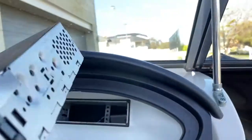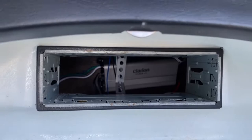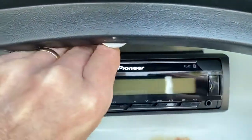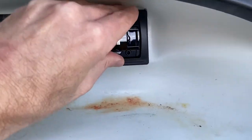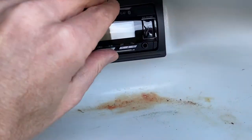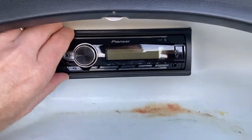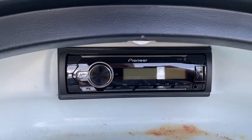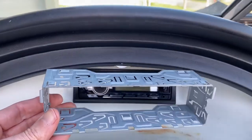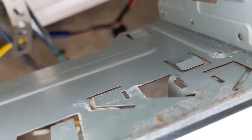The old head unit has now been removed, leaving me with the cage from the old unit. I tried putting the Pioneer unit straight into that cage and it fits, but it doesn't feel super secure - there's a bit of a gap under the trim ring and it wobbles around a little. It doesn't actually lock into that cage, and if I remove the trim ring the whole stereo falls straight through. So I'm going to use the Pioneer's own cage which locks it in properly.